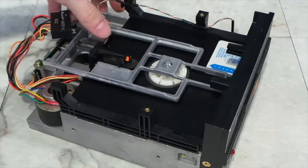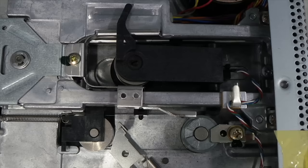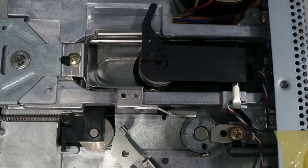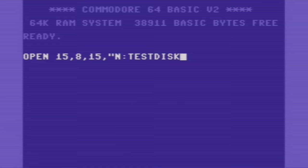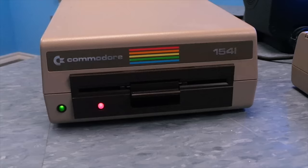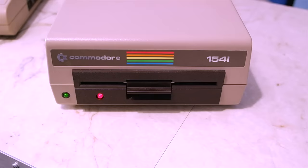One interesting fact about Commodore DOS is how it handles the location of the head. Most disk drives used sensors to figure out the head location. Apple disk drives eliminated the sensor to reduce cost and instead just sent the head back 40 tracks every time the power was turned on, usually causing the head banging sound. This ensured the head would be at track zero before any disk access started. Well, Commodore drives also had no sensors, yet they don't bang their heads every time you power them on. One time you are certain to hear the sound is when you format a disk. Then as the disk is being formatted, the track number is written to every single track on the disk. That way, even on a fresh power up, when you go to read a disk for the first time, the drive will know exactly what track it's on by just reading the header to the track. So under normal operation you won't hear any head banging.